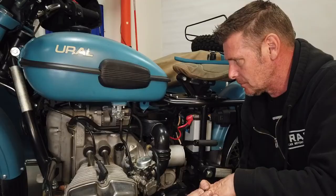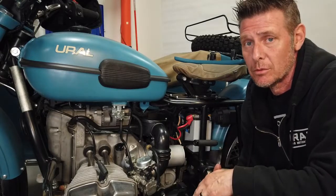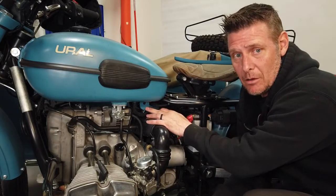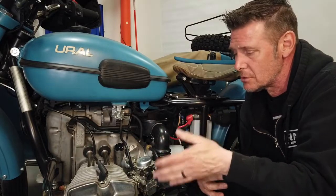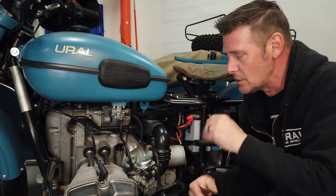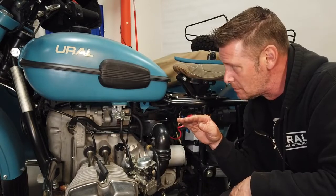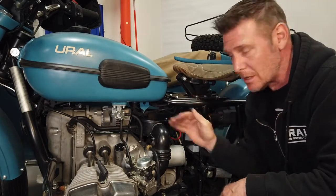The reason for removing the whole air filter assembly was that even with the airbox lid removed, there's just not a lot of clearance to remove the old filter and install a new one due to the lower gas tank mounts. You may ask: is the new air filter assembly retrofittable to the older bikes? No, it's not — primarily because of the gas tank mount. The new fuel injection airbox design, introduced in 2014, uses a top snorkel mount right where those mounts are, so in 2014 the rear gas tank mounts were moved to the top of the backbone to accommodate that airbox.